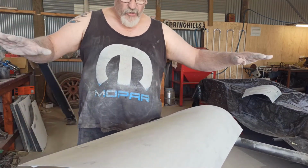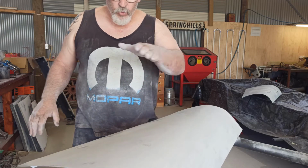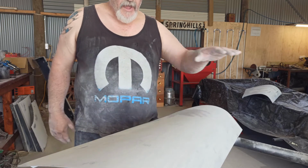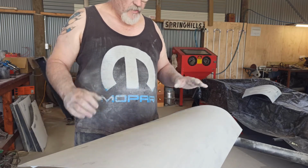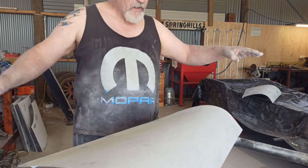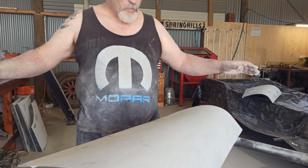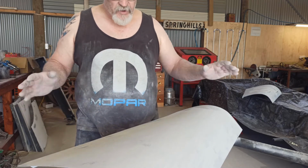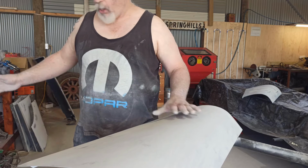But yeah, you've got this nice flat panel, and all of a sudden you've got this little whoop in your paintwork, a little patch like that. You might have 3 or 4 of them where you've had a funny spot, and you think, oh, just rub that out, I'm just trying to blend it out. But that's when you maybe put another coat of high build on it, sanded it out by hand with a small block or whatever.